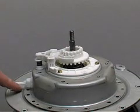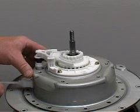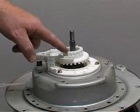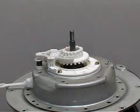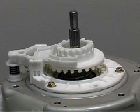There is a linkage here connected to the clutch motor. As the clutch motor rotates, it pulls the clutch assembly to move the position of the coupling. Depending upon the coupling position, the basket will be rotating with the infuser or will be locked in position.